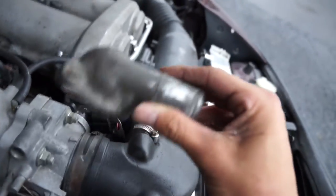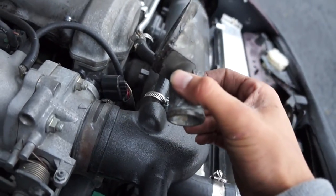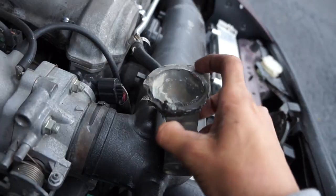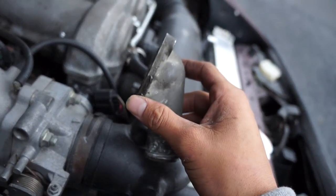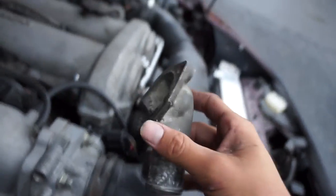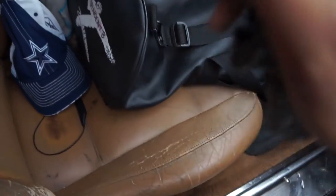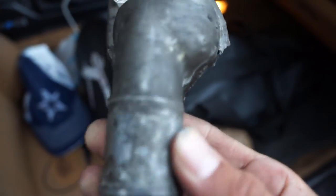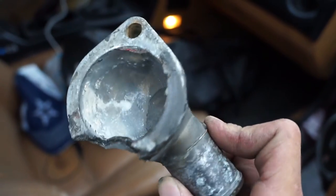What I recommend: buy a bunch of that sealant — it's called something like RTV — and don't tighten it too tight. When you tighten anything, you tighten it until it's snug and then you crank it one more time — that's when this cracked. It's a tricky situation because it's aluminum, not real metal. So the tip is: use a lot of sealant and don't overtighten it or it'll crack and you'll have to go find a new one.